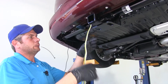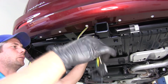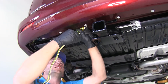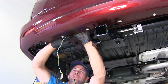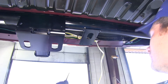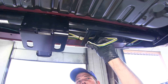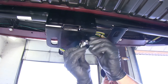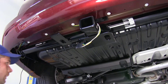For our four-pole, we want to decide what length we're going to need to make our connection. Once we've determined that, whatever excess we have we'll just tuck up and secure to the wire loom with the other parts. We can use a zip tie to attach our four-pole, or in our case we're going to bring it around the hitch, bring our dust cap right around there, and keep it from bouncing around while we head down the highway.